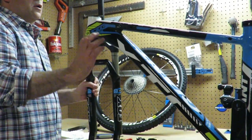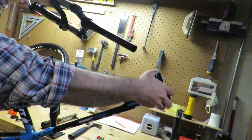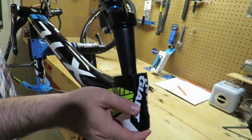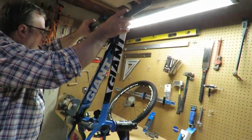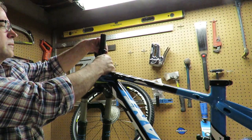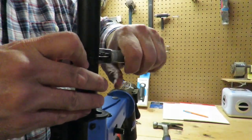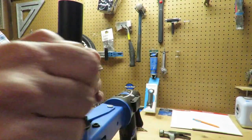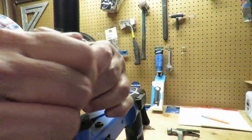As you hit a hill, you press the lever on your handlebars down two notches or all the way, and the fork hardens up. Trail is in the middle, and Descend is as soft as it can get, giving you a cushy ride. For a brief overview of how we installed the fork: first we set the bearings in the head of the frame, then flipped the bike over and inserted the fork from the bottom. We flipped it back over, attached the top bearing cap, added spacers, stem, and one more spacer, then cut the fork pipe with pipe cutters and capped it off.